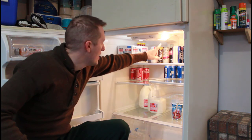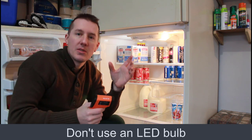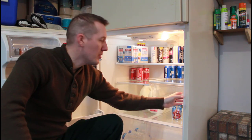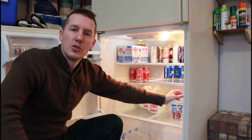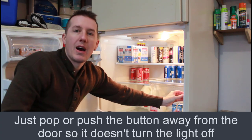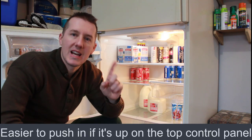And why would that work? Because you have one or two light bulbs up here, and a light bulb can get up to 200 degrees Fahrenheit on its surface. I'm talking about the older incandescent light bulbs — this doesn't work with LED bulbs, those won't get hot enough. That bulb turned on less than a minute ago and it's already up to 135 degrees. So if you disable this door switch, those light bulbs will stay on and heat up this thermostat. Your door switch might be up here on the control panel or down here on the side like mine. Basically, take a flat head screwdriver and pop that door switch out so that when the door shuts, the light stays on. That's fix number two.